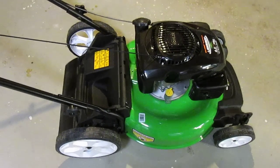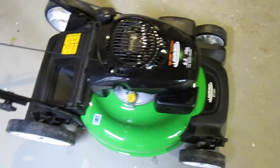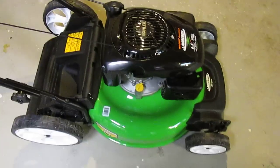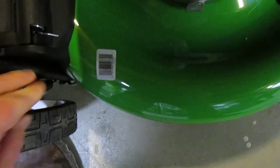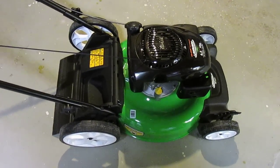Now, one of the new features of this Lawn Boy is the easy height adjustment, which means you can change the height of the mower deck just by moving two levers instead of the usual four. How you do that is you just come down next to the mower, grab the one handle, and slide it down forward. You go to the rear wheel, slide it down the same number of notches, and there you have it — your deck has been lowered instead of having to do each individual wheel.